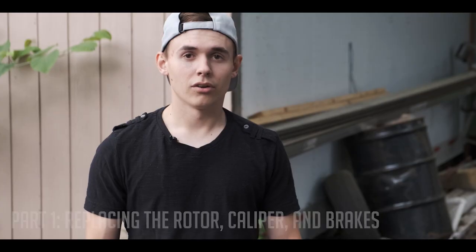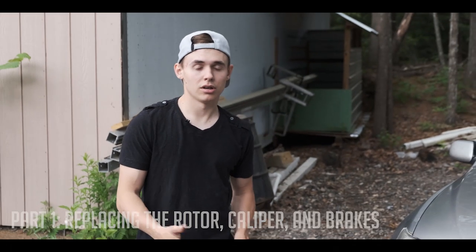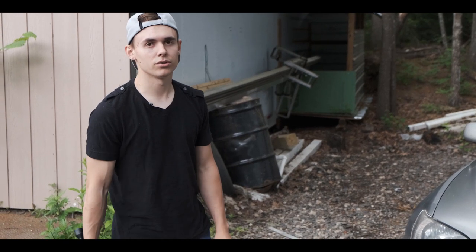Hey, my name is Phil, and I'm going to be changing the front brake system on my car. All right, before we raise the car, we're going to take the lug nuts off with a 13/16. It just makes it easier for us to take the wheels off when it's raised.